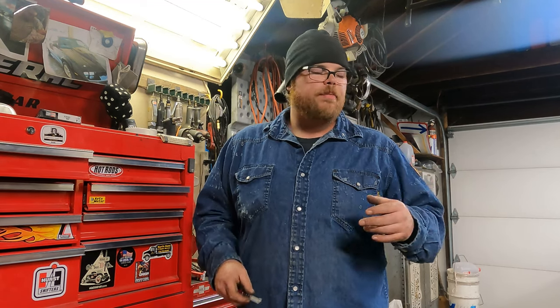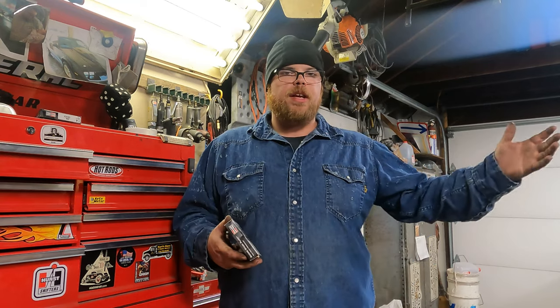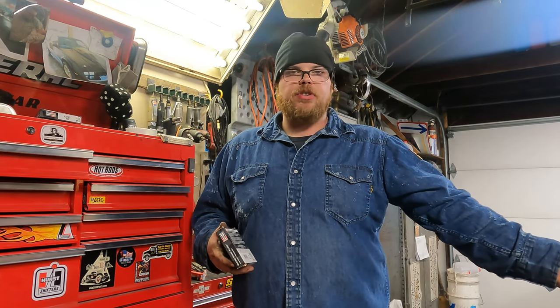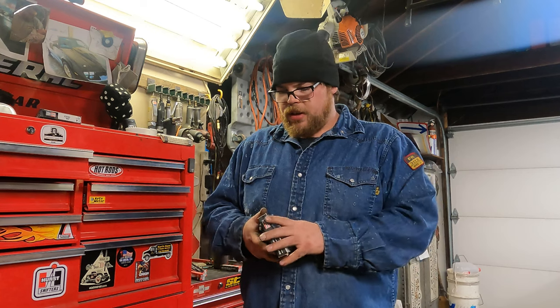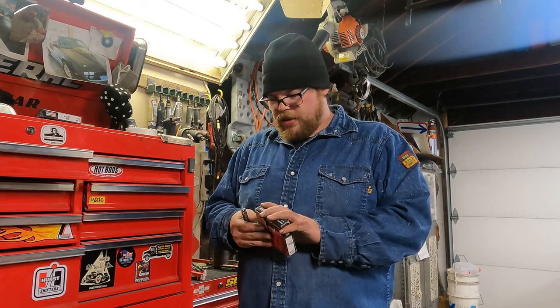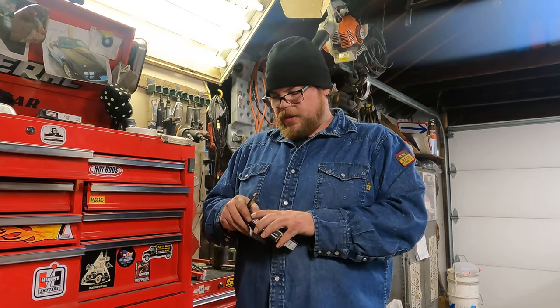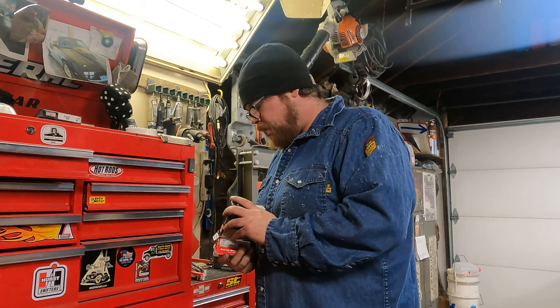I mean, my philosophy is you're jamming two times the amount of fuel inside that cylinder than what you were on gasoline. So my theory is that a hotter plug is just going to be a more efficient burn, because the plug's going to stay warmer, right? Just because we're running a hotter plug doesn't necessarily mean the chamber, the cylinder is getting hotter. It means that the plug doesn't dissipate the heat as fast, so in turn the plug stays warmer. Now, that can cause a few things. You can get into detonation. You can get into the motor dieseling. The motor won't shut off when you turn it off. It'll just diesel and keep running.